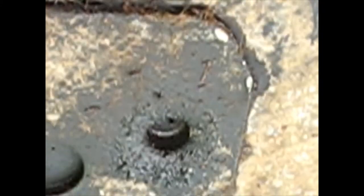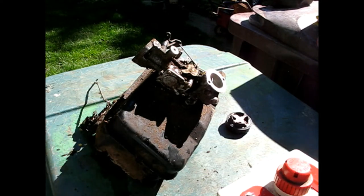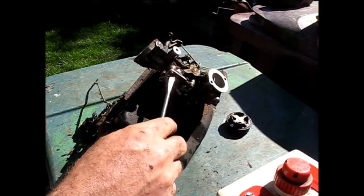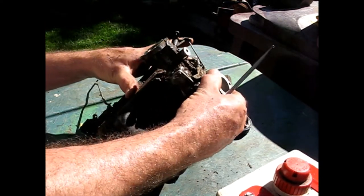It's about quarter-inch — you could probably not quite fit a pencil through there. Not terrible. So for now I'm going to continue with the carburetor rebuild, assuming I'm either going to get another tank or fix this one. I'm prying and there's a seal under there, and then there's a diaphragm in here — there's a diaphragm here and one on the bottom. The one on the bottom is also the gasket.